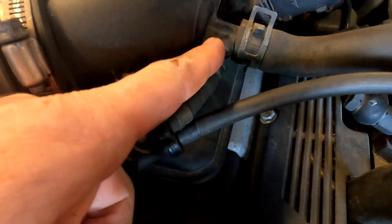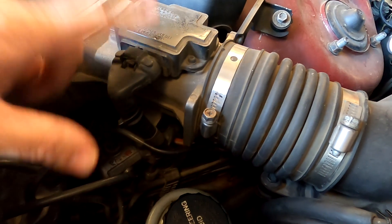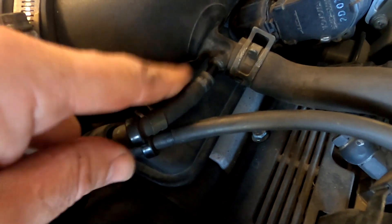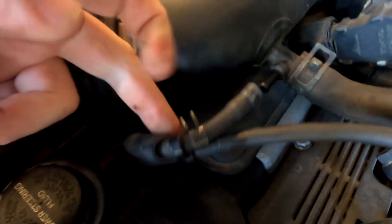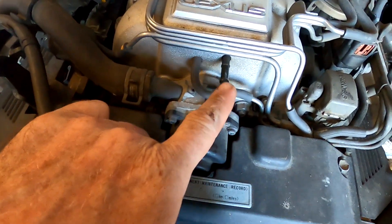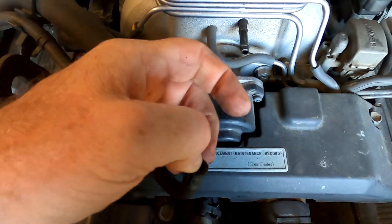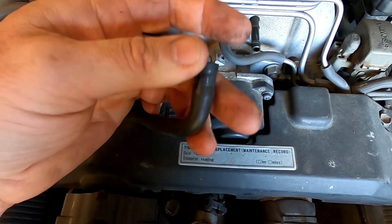The air supply is from your intake going into the engine, so it needs to be monitored by the airflow meter, coming out of this little tube — please be careful not to break that little tube off. The rubber goes down there, comes back up and into the engine here. You can see this one is split as well, so we're going to be replacing those hoses. I'm just using a generic aftermarket quality rubber hose.